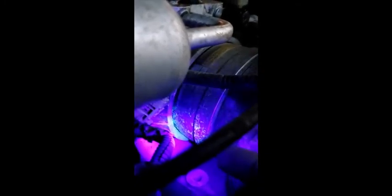and that should fix it. Check it over here on this side. See on the bottom down here. Bottom down there on the compressor. It's just leaking real bad. Okay, over here on the accumulator, I didn't find anything over here. So that's good. I didn't want to have to tear all this apart anyway. This dryer right here, this is all new.